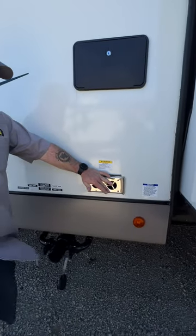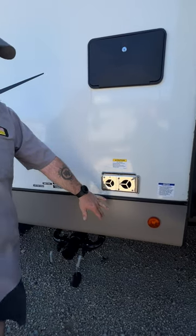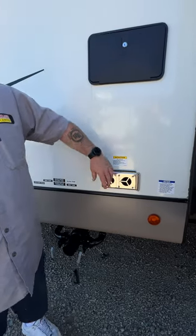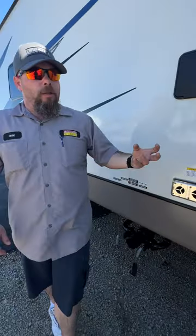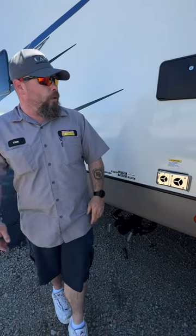This area here is going to be our furnace — pretty much your intake and your exhaust. You don't want to put anything in front of it; that's what the caution sticker is for. We usually recommend mud dauber screens to keep mud daubers and wasps out of there, because they can fly through the ductwork and actually get inside the camper.